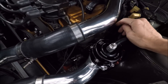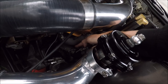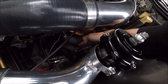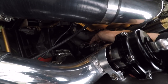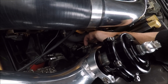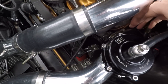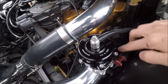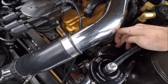I'm going to start at the turbo. Way down in there I have a T3/T4 hybrid turbo — it may be a little different than what you're running. The flange coming off the turbo I believe is a two inch. There's a 45-degree coupler that points it straight up, and then a small piece of metal joins two couplers. This coupler here is a bending reducing coupler: it starts at two inch, bends 90 degrees, and the flange is 2.5 inch — a very helpful coupler for this build.